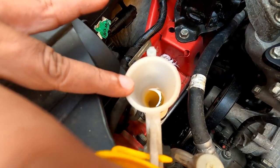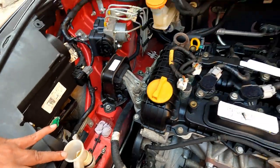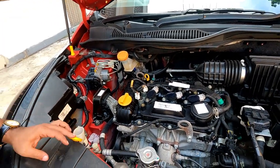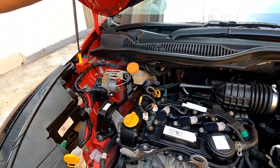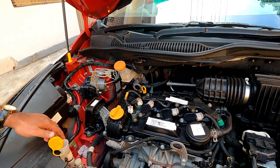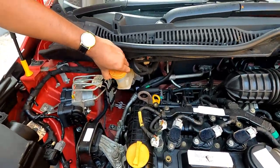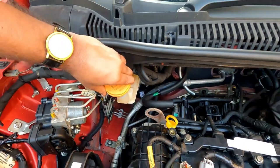You need to check your wiper washer fluids and add a good quality screen shampoo, so every time you get a clean windshield when there is any mark or mud on it. Screen shampoo also works as a lubricant — it lubricates the pump and the screen while you run your wiper blades. Also check your brake oil condition; brake oil should be up to the brim, so make sure it is topped up.